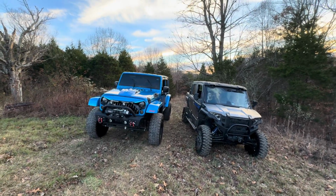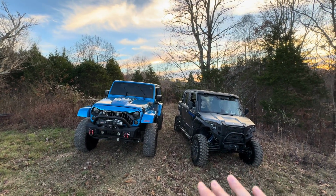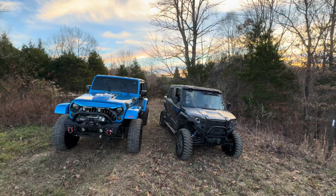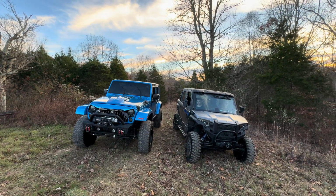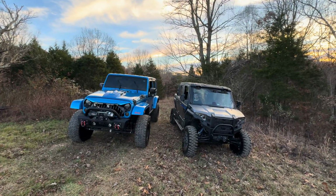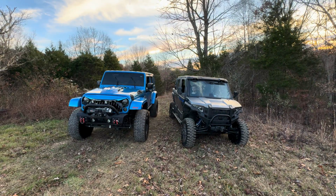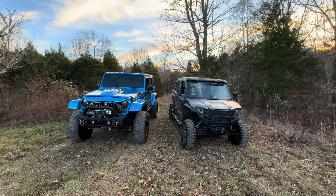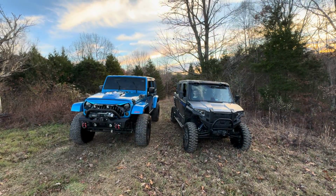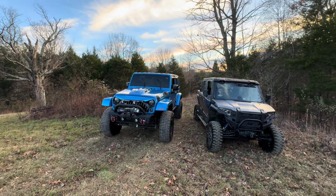Right. And that's what I was telling people coming up the hill, that you were getting hot going through the trail. That's because your fan is run off your alternator belt and everything else. No, it's got electronic fans. It does have electronic fans. The fans are so small and the thermostats are set so high on the 3.6s, it's set at 203 degrees, so the fans don't kick on until 203. After the thermostat opens up, it takes forever for it to cool down.